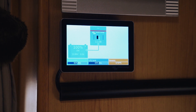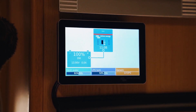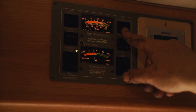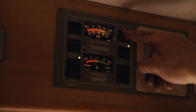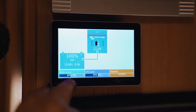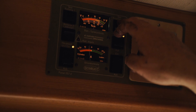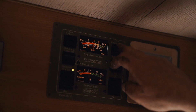What I'm going to do is run out some water just to have a look and see. I'm wanting to run water out until I go below the 50% mark, so it'll be a few minutes. I'll expect this one to drop to the quarter mark any moment now, which means it's just under half. This is what I don't like about the old sensor — you've got basically 25% increments, whereas on this new sensor I've got 1% increments. As you can see, this is going down — it's gone down to 47%. May need to sort out the calibration a little bit, but that's basically working well.